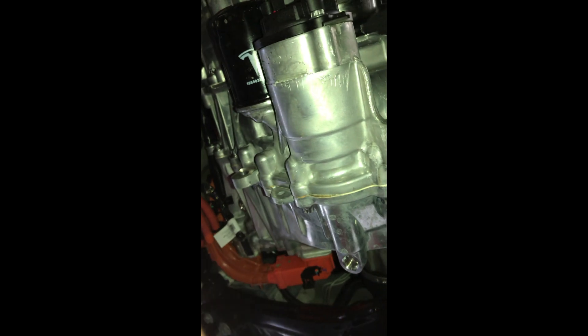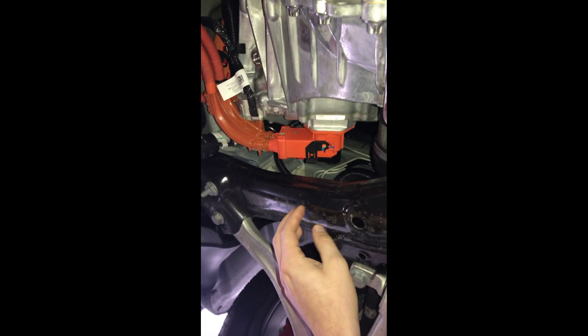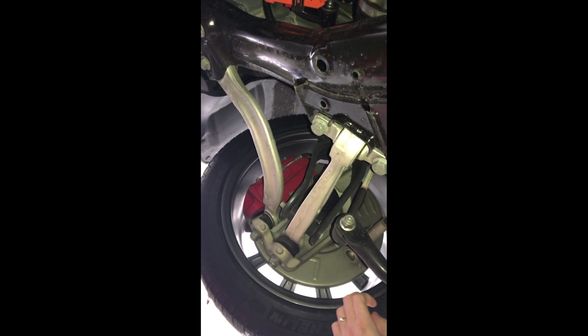The problem is that they will get seized up. The reason for this is regenerative braking. When regen is doing most of the work, these brakes are not being used. As the Tesla technician explained to me, because most Teslas are in regenerative braking, the brakes will actually seize in the caliper saddles to a degree since they're not being used.